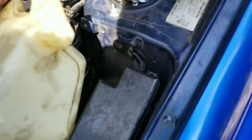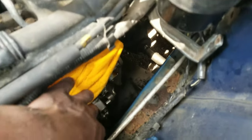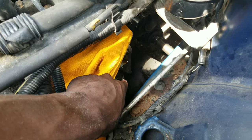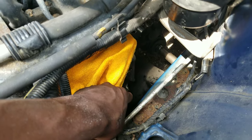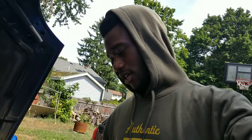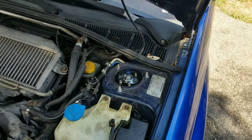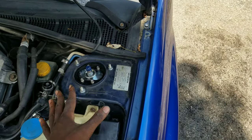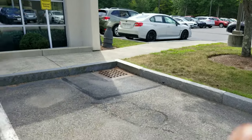It's like a half-moon crescent gasket piece — I didn't even know it existed until yesterday. It sits right back there where that little indent is. When we pulled it out it was super brittle and had no gasket sealer on it at all. We were gonna put some on, but as it was sitting in my hand I moved it a little bit and it started crumbling — I didn't give it any force, it just started tearing itself apart. So I'm gonna go to a dealership to grab a new part. Quick tip for new guys: whenever you're taking stuff off, just put the bolts back on where they came off so you don't lose track of them.